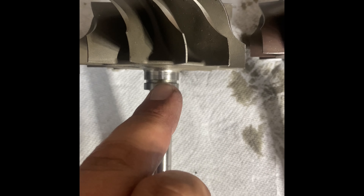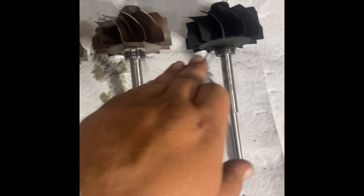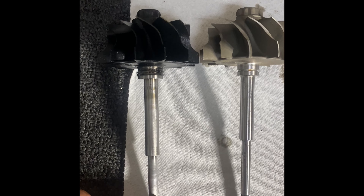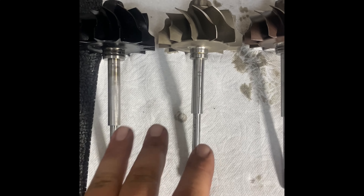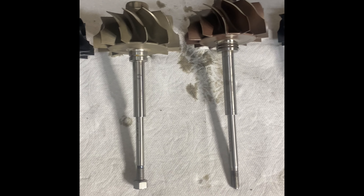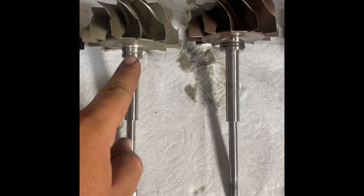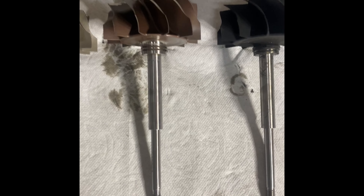We will see there are a multitude of piston ring designs. Some are two-in-one slot, two separate, single, two separate. Different part number chargers will have different piston ring locations. Just because your turbine is an 84-70 does not guarantee this is the piston ring combination. Turbine wheels are not necessarily interchangeable unless the center section is set for whatever piston ring design the turbine came with and whatever piston ring the turbine you want to swap to comes with.